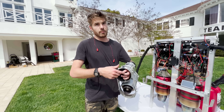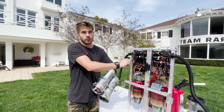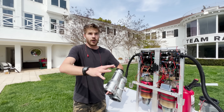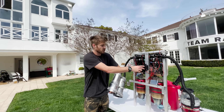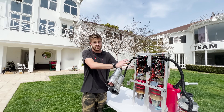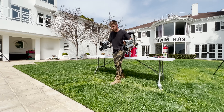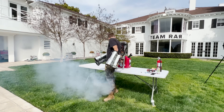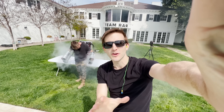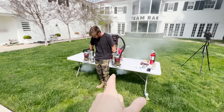If I trim up the throttle and let go, that sends the signal to start the engine, and this one breaks it out for all the engines. So all the engines get the start signal and run independently. Effectively, this is what takes one signal and breaks it out to all five. We initiated the startup sequence — the engines killed themselves, potentially some kind of fail-safe. Both engines went out, and we wondered why. I might have accidentally let go of the kill switch.